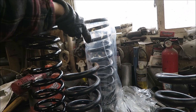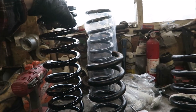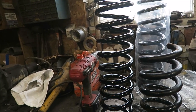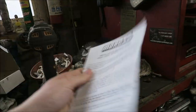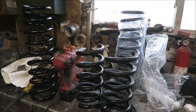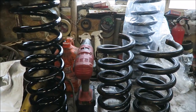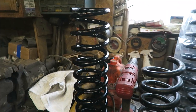There was an extra coil so they would have been too tall. I do think I'm gonna have to order those drop spindles too. I'm pretty sure these are like a linear rate coil. I don't remember what the spring rate was, but I know other people have cut them down so it'll be fine — it's just deciding how much we want to cut. On the other ones I cut one coil, heated it and lowered it down, and it dropped about two inches.